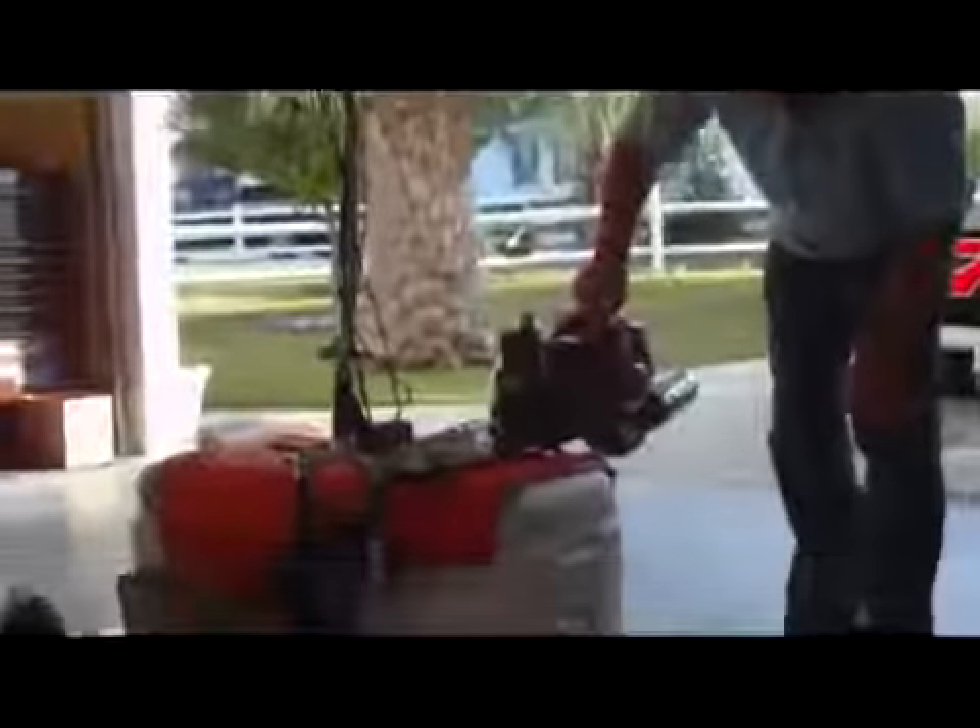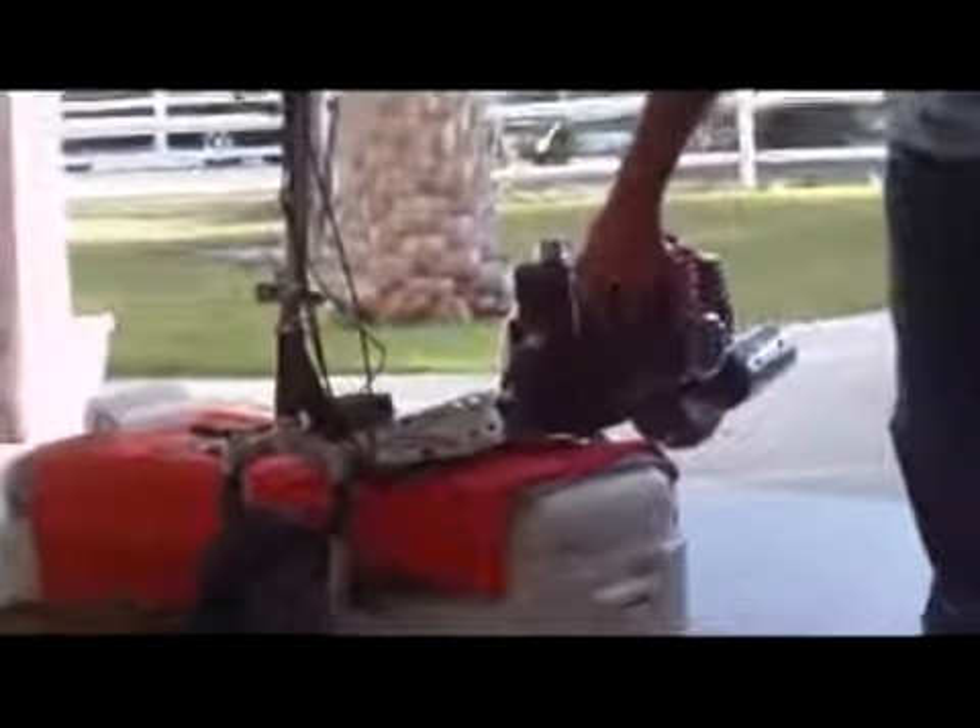I'm going to give it a little start for you. You have your prime bulb underneath. When it's cold, you need to put the choke on, which is up — you'll start it in the up position. In order to take off, you must put it in the down position, otherwise it will stall. So ride it in the down position, start it in the up position.